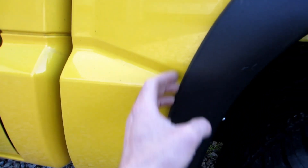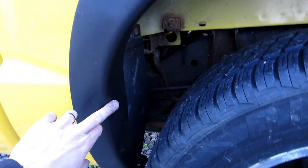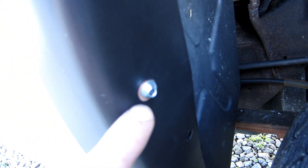On the back, the only cutting I did was where the Ram body line notch was on both sides — I just cut those off and fanned them to meet the thickness up here, then sheet metal screwed it all together. One thing to note: in some areas you'll blow through if you tighten too tight. I put washers — it's good practice to put washers anyway so they don't blow out and it grips better.